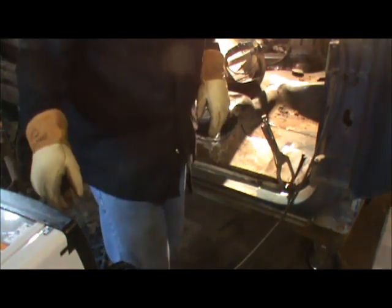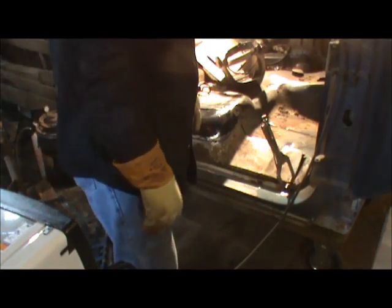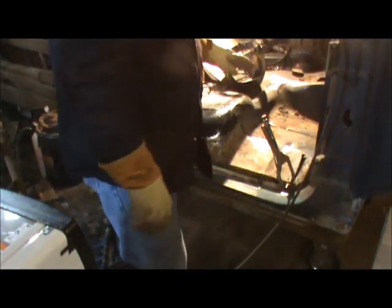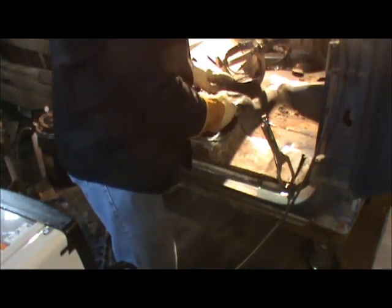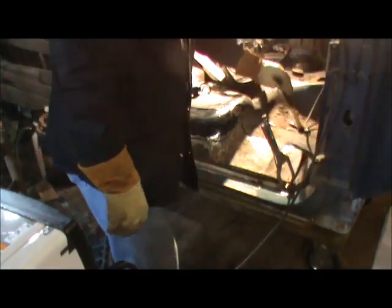And we're gonna stay on one with about a 35 feed rate. We're gonna go ahead and get a tack in it up here, tack in it back here. And then as we fold it around, we'll tack it. We'll probably do a little beating, get it all lined up.